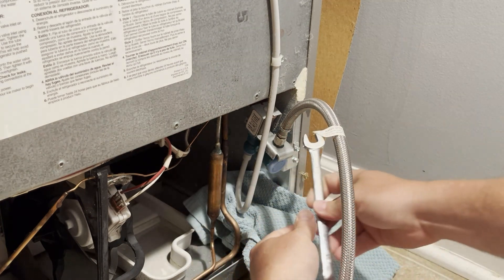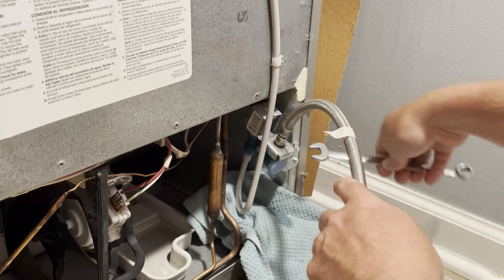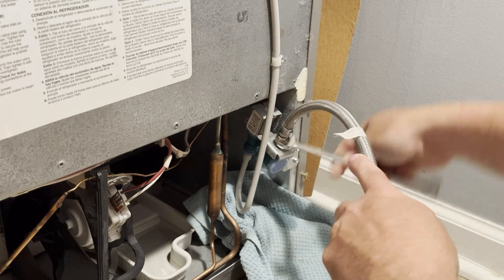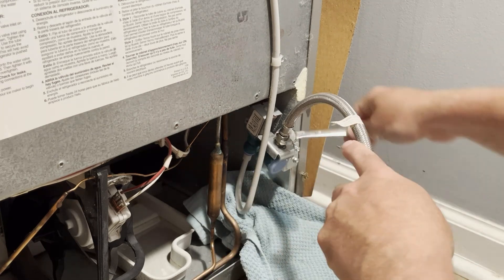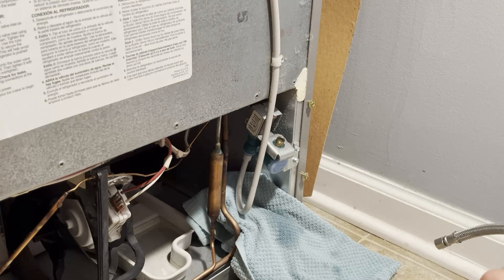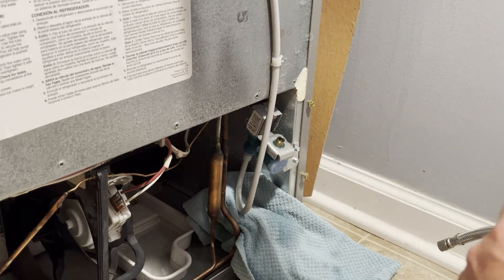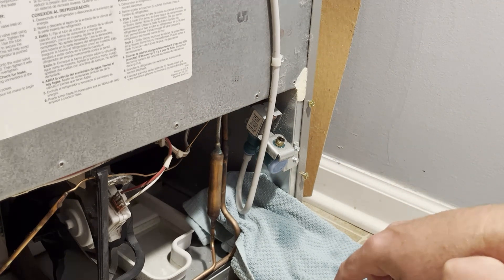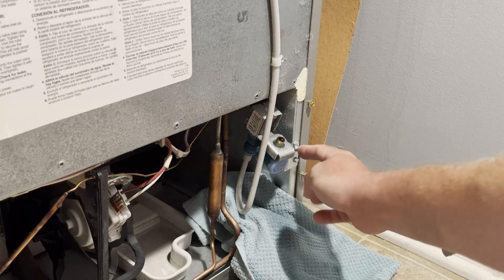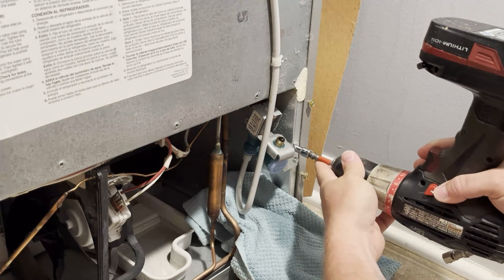The water line connection for me is a half-inch wrench — it shouldn't be that tight, so go ahead and remove it. There's a little water dripping out. Be careful when handling the water valve and the water line that goes up to the filter housing — we don't want to damage or crack this hose. If your refrigerator is pretty old, it could be a little brittle. Next, remove the two bolts that hold the fill valve onto the fridge — it should be quarter inch, just like the access panel bolts.